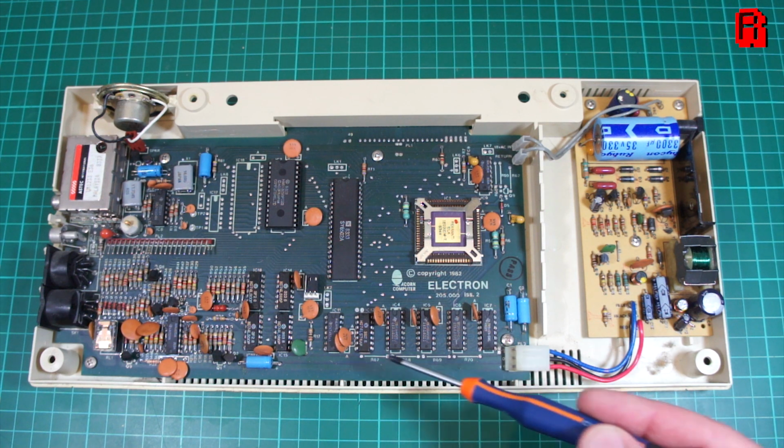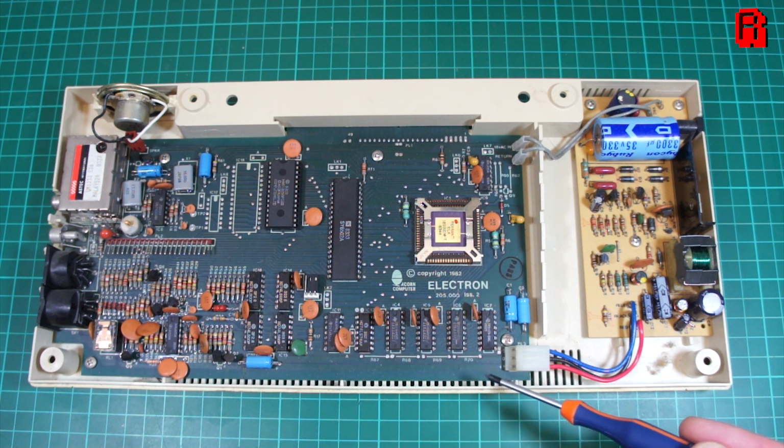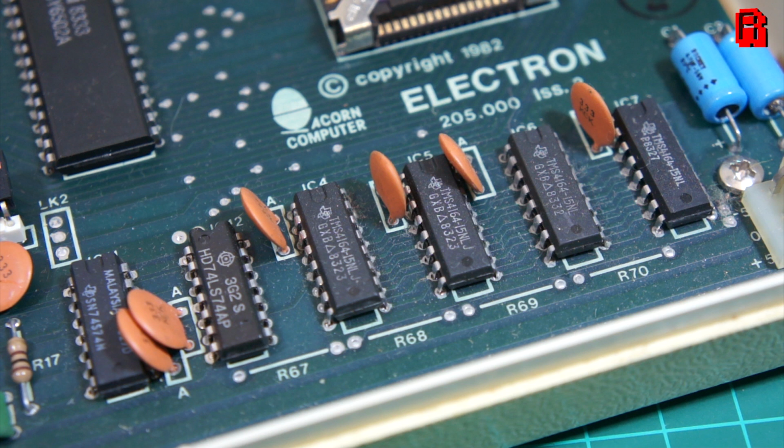The RAM chips located here amount to 32 kilobytes of total RAM. To reduce cost, the RAM was spread over 4 64 kilobit chips and was addressable over a 4-bit memory bus. This is in stark contrast to the common practice of the time of using 16 kilobit RAM chips and an 8-bit memory bus. The result of this quirky decision was a machine that was cheaper to manufacture, with memory that was incredibly slow to access even for the time.